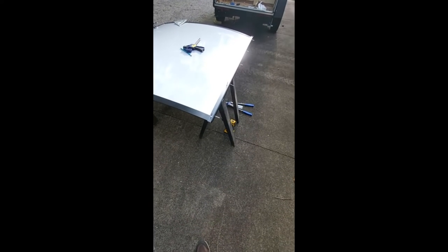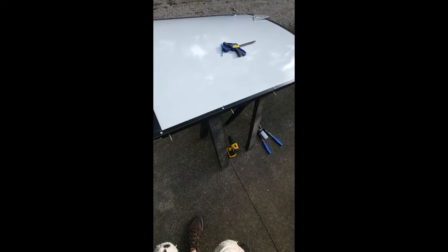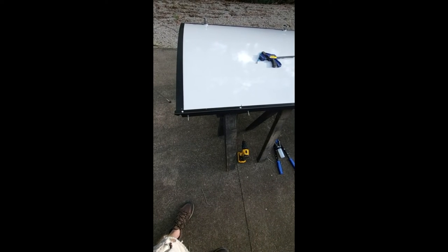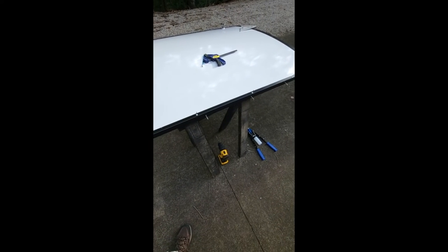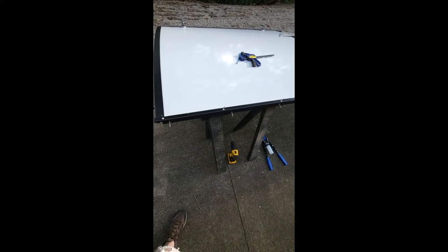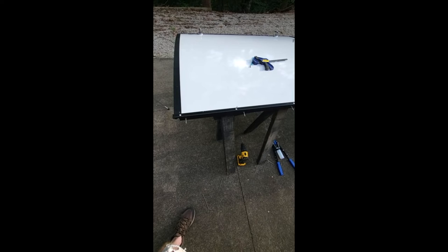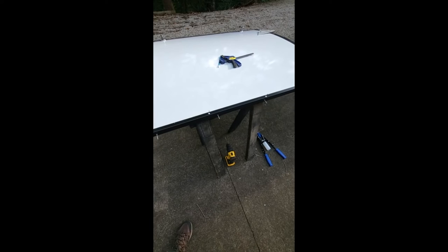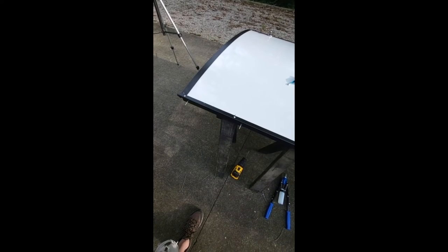What we have now is the painted new lower section of the hurricane hinge, and I've reattached it to the door after I put a bead of clear Pro Flex down underneath it so as the rivets pull down it's going to squeeze some of that sealer out — I want to make sure I had a good bead of sealer underneath it, and then we'll go back and seal the edge once we get the hurricane hinge attached. I didn't paint the rivets — I've never had good luck trying that — so I'll go back and touch the rivets up once I get them pulled and the door on.